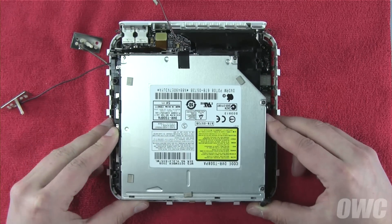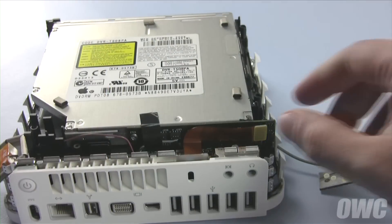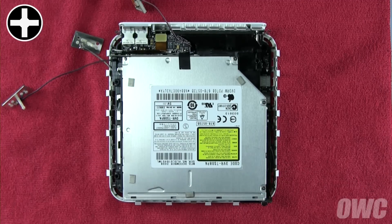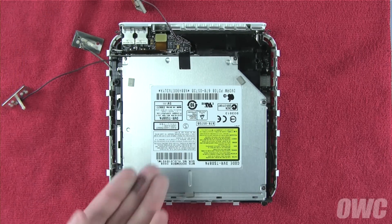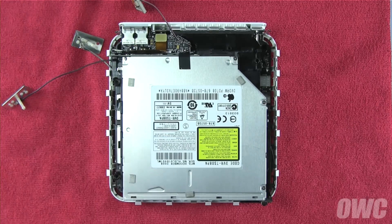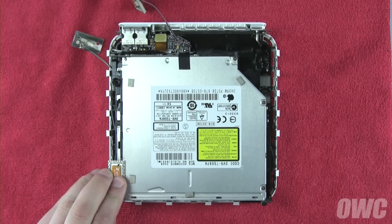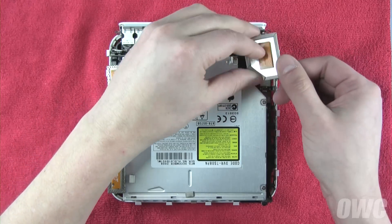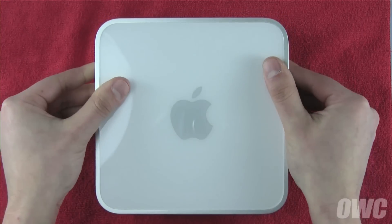Replace the drive assembly back into the base, making sure not to pinch any of the antenna wires. You may need to adjust the positioning a little until the assembly fits into place. Next, reattach the drive ribbon cable. It's now time to replace the screws. The large screw goes in the front right position. The three remaining screws are all the same size and go in the three spots you removed them from earlier. Place the springs on the antenna posts. Then attach the antennas themselves by pushing them into place. For the large antenna on the right, you may need to squeeze the clip you used to remove it in order to replace it. Once that's done, you may now replace the top cover and push evenly around all the edges until it clips flush back into place.